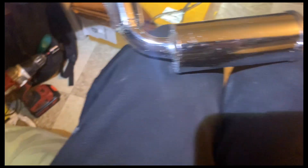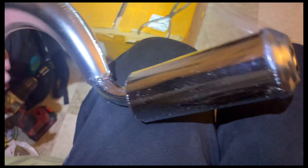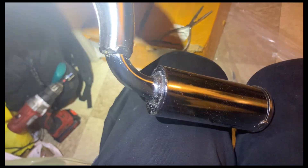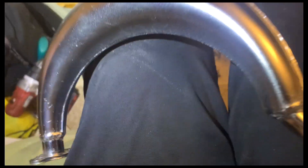Here's the exhaust I'm going to be using. I just got something because I thought it was a hundred CC, and hundreds are much louder. So it's basically just a really cheap banana pipe expansion tank with a muffler, which is nothing more than a wide pipe with a small pipe inside of it — there's no baffling. I figured it might be better for the bike because it would help quiet it down some. But being that it's only an 80, I don't think it's going to be a big deal. I do have the stock exhaust which is black — I ordered this and it came silver instead of black. The stock exhaust gasket — I tried to open it up because it was much smaller and the Dremel got away from me. It's obviously trash now.